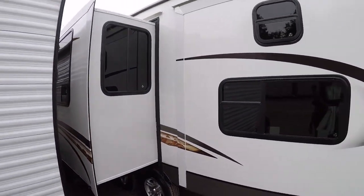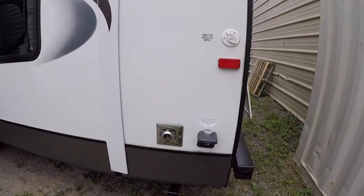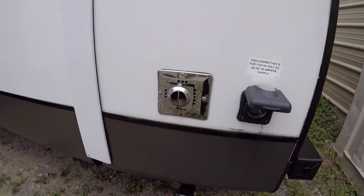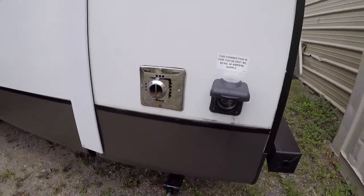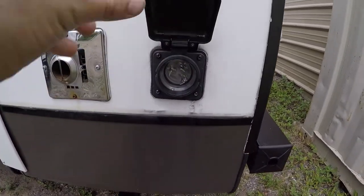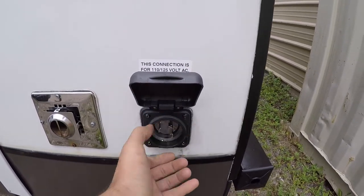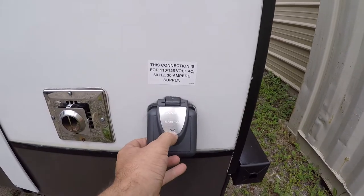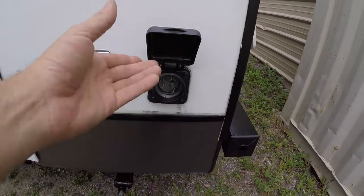On the back side you have that slide — this slide isn't open yet, that'll open right there. You have your furnace exhaust right here, that gets very hot, so you don't want to put anything in front of that — keep that area open. You have your 30-amp plug for that cord shown at the front: simply slide it in, give it a twist, and lock the ring on. There's a little blue indication light here, so when it's connected you'll see that blue light showing you it's powered up and ready to go.